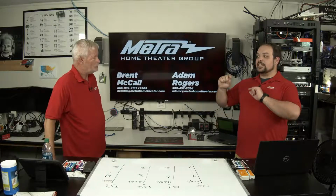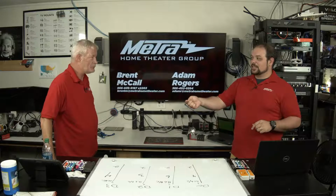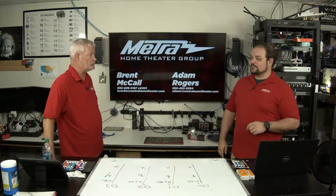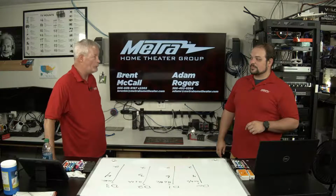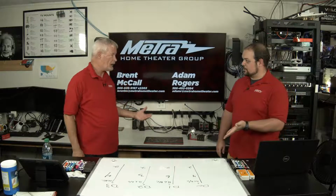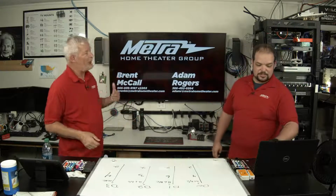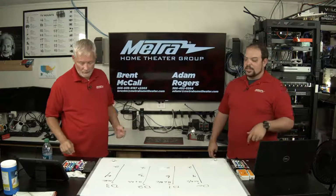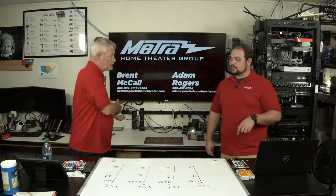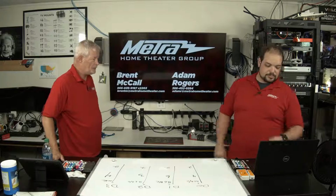Now, the EDID is just saying, do you have the ability to decode what I'm about to send you? Well, there's a lot of additional instructions set up in the EDID for Atmos. Now is that on the current stuff, or is that on 2.1? Yes, and that's why Atmos can absolutely work backwards. Gotcha. But you still have to have those capabilities. Right. Remember, Atmos is in 2.0 products. Yeah, correct. I just didn't know if they were upgrading something additional on top of that.